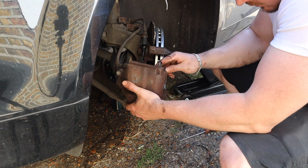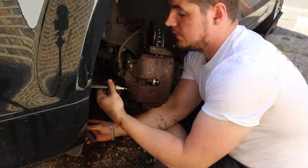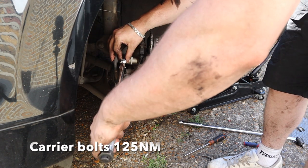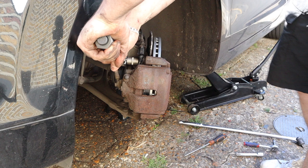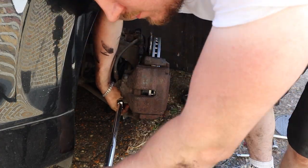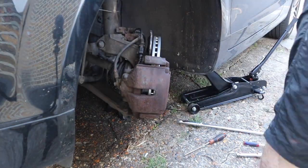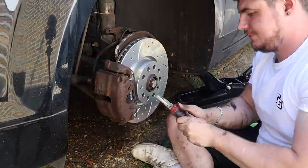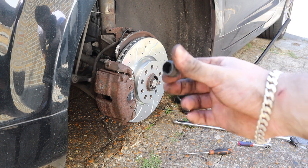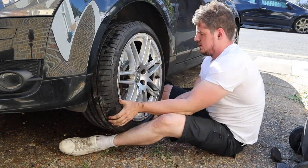Let's make sure it fits in the right place with the brake pads and let's do up the pins. Now let's torque these down to spec — we are getting a bit professional now aren't we boys. Putting the retaining clip back on — put it in one of the holes first, bend it into place and put it in the bottom one. And can't forget the pin covers.